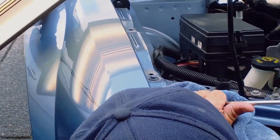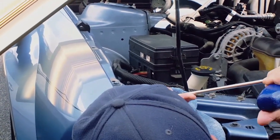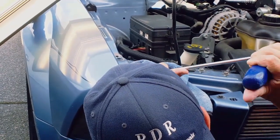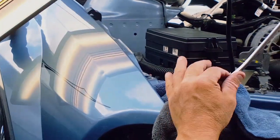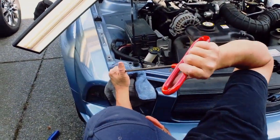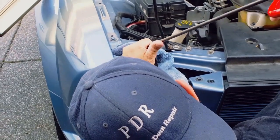I just really slowly walk it all the way up into that line — I don't start at the body line. Honestly, for my first ten years I would always start at the hardest part first, but in my later years I've learned you want to make the dent as small as possible, as slow as possible. There's a little bit of movement, but I'm not getting the right angle. I'll try the tool named Mark — one of my customers named Mark said 'name it after me,' so I did.